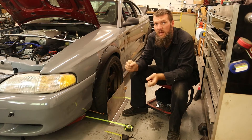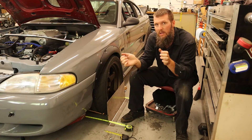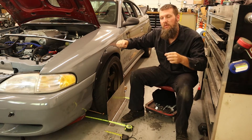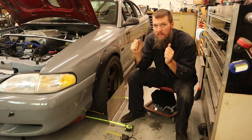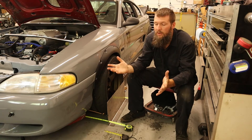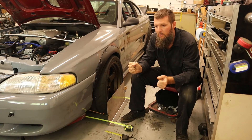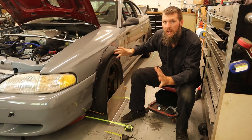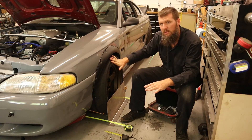If you're driving down the road and your steering wheel is turned a little bit, that is all set by the toe. You can go in and lengthen one side and shorten the other side of your tie rods to get your steering wheel back straight. That's one way to know if your alignment shop did a good job — if you drive the car and the steering wheel is straight when you're driving straight, everything was done correctly. It might be slightly off on a home alignment since we don't have computers to correctly calculate all the distances, but this will get you really close and it's close enough for a race car.